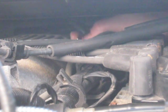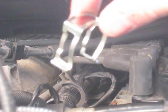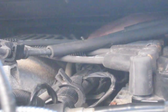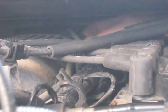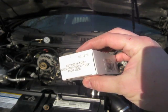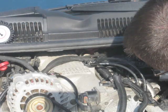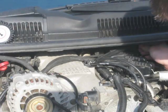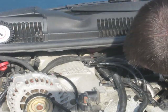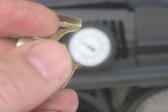Unsnap that quick retainer. If you watched my previous video, you'll see how much I hate the snap rings. That job's a whole lot easier — don't have to remove anything off the spark plug wires like I did in the previous video because I had to get a tool to get the snap ring out and didn't have any room. Got my new fuel pressure regulator, part number 23045P. Let's see if this one does the trick.